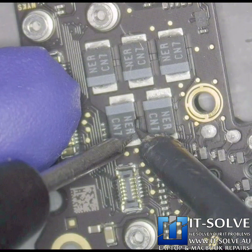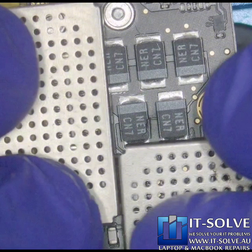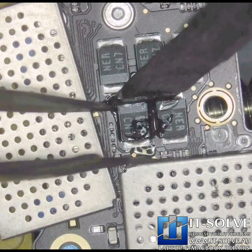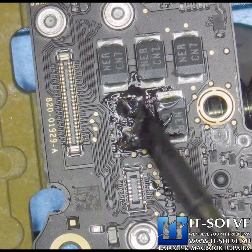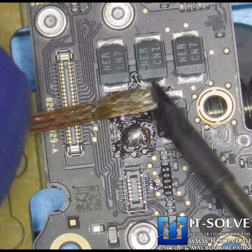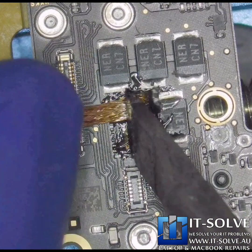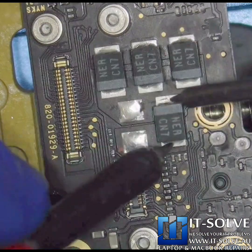They're connected in series and you can see how the bottom left one has cracked. Usually such a crack can happen when there's consistent overheating within the system. All of the newer MacBook Airs do not have fans anymore, so there's no natural way of getting that heat outside. It gets stuck within and unfortunately causes these ceramic capacitors to crack quite easily.